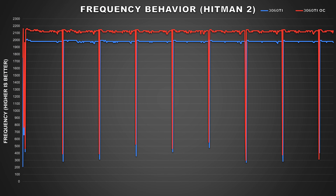First, I wanted to go over the frequency behavior of MSI's RTX 3060 Ti Gaming X Trio out of the box. Hitman 2 was used with gameplay for about half an hour to see what kind of load frequency behavior the card exhibits in a real-world scenario. At stock, the 3060 Ti maintains an average boost frequency of around 1944MHz, considerably higher than what MSI officially advertises — about 100MHz higher. On the graph, the card is boosting often and sustaining around 1960 to 1980MHz, which is pretty good. Those dips only occur during scene changes.